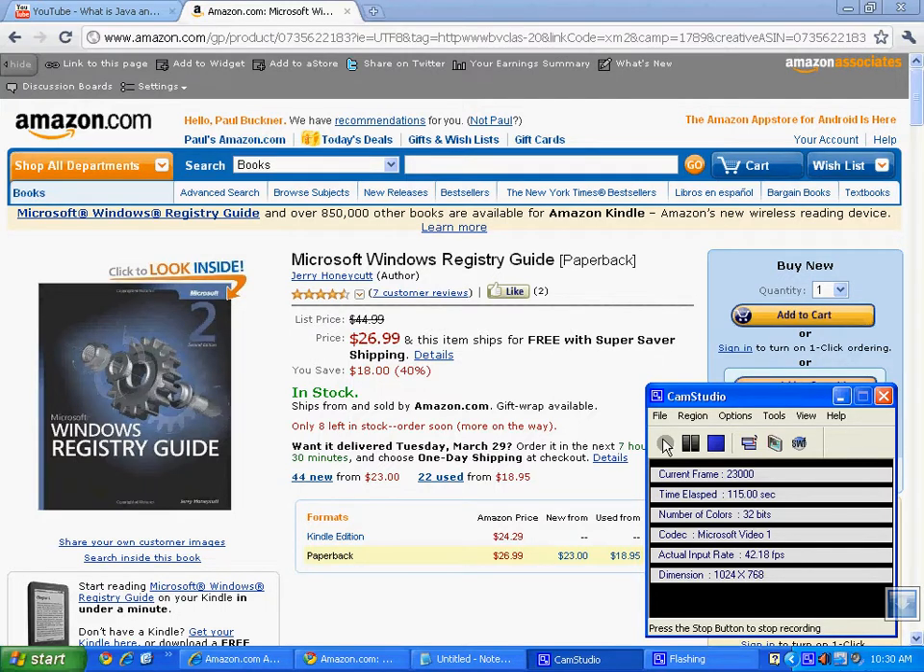Keep a little laptop bag in your vehicle with a few essential things: a couple of extra network cables, some USB cables, and similar items — you can get them off Newegg. Maybe a little PCI network card or USB network card for replacing something that's been blown out on-site. It's a great way to get around problems, especially if you buy a network card with drivers built in for older versions of Windows — so it'll automatically work from Windows XP all the way up through Windows 7 and beyond.